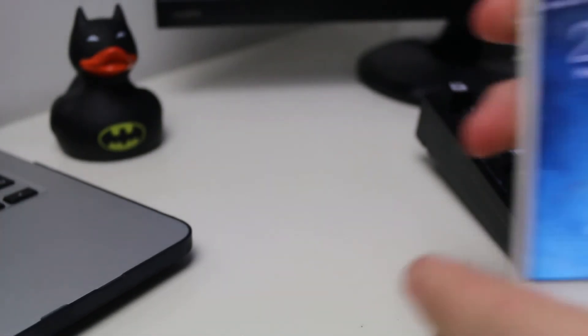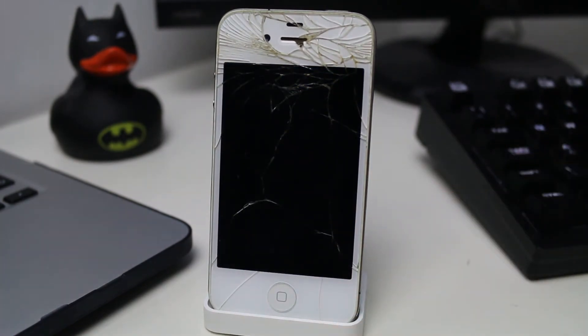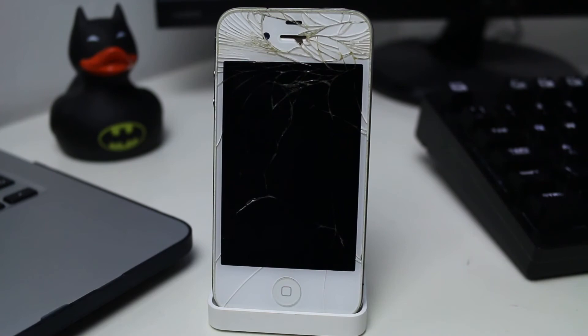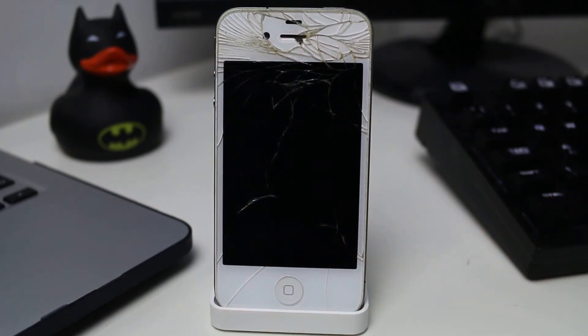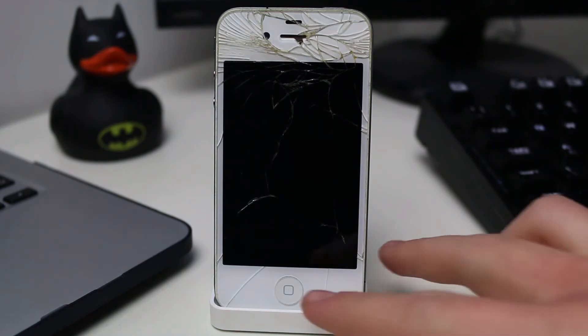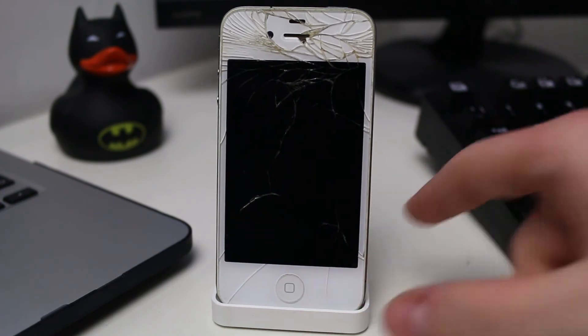I'll lock the device and give it about 10 seconds, then try to unlock it — though it should actually reboot and boot into iOS 6 before that. If we tap the Home button around about now, it doesn't actually turn on, but we should see the backlight come on and then the boot logo. If you chose verbose boot like I did, you'll see a load of strings of text on the screen while it's booting up, rather than the Apple logo.